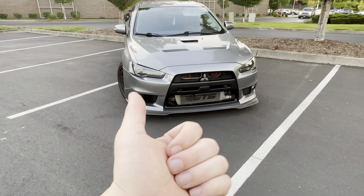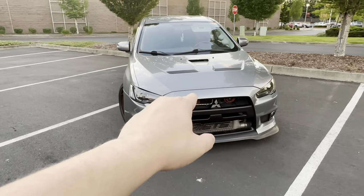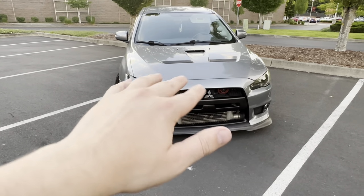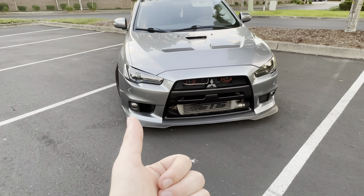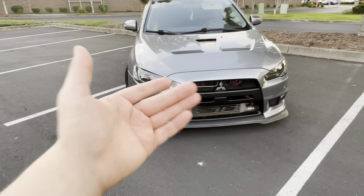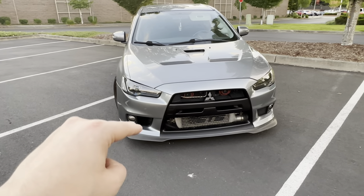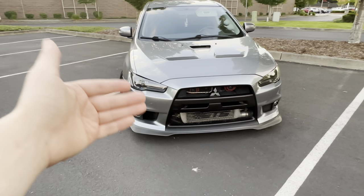The AGTs are the ones to go to. He offers a ton of different solutions — you can visit his website linked below. He does a ton of different turbos not just for Evos, but for Subarus, SRT4 Neons, and BMWs. You'll want to go with his 55mm or potentially his 62mm stock location turbos. Those turbos are incredible — I'm actually running his 62mm with the upgraded 25-pound billet wastegate and that's how I make the power I'm at now. For what you may be looking for around the 450–500 range, the AGT 55 is pretty much the nastiest street turbo you can buy — very quick spool, virtually no turbo lag, rated for 500–550 horsepower, especially on E85.